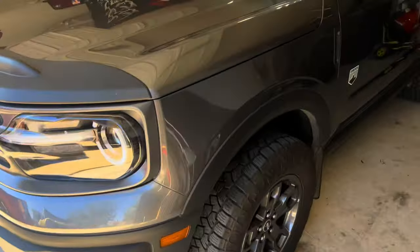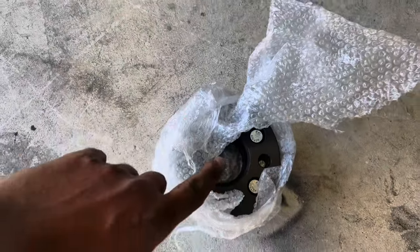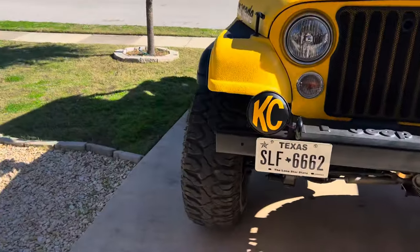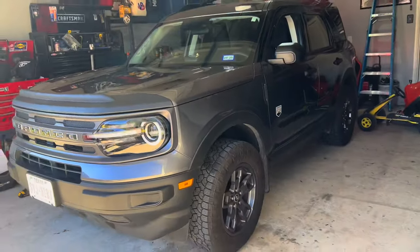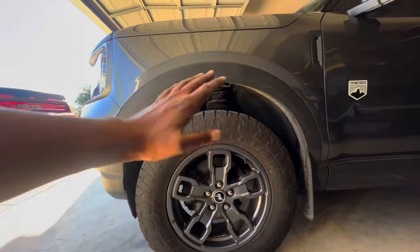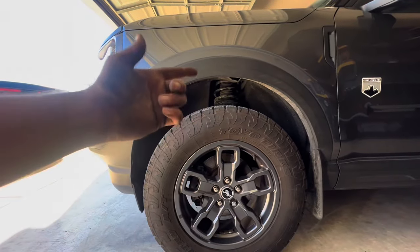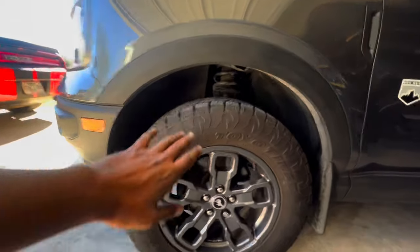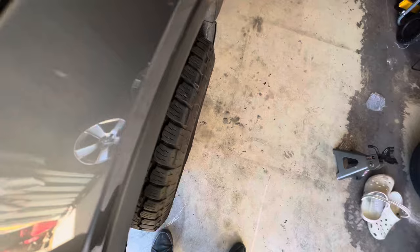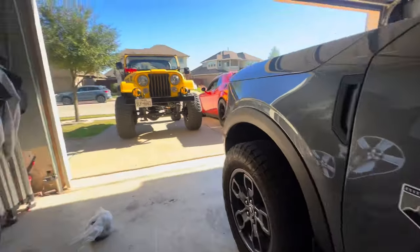The front is done. I also got a set of wheel spacers from Titan — Titan wheel spacers — I think I got an inch and a half. It's very subtle; if you look from the top you can see the tire kind of poking out. I was really trying to mimic the fitment I have on the Jeep, a little more aggressive on the Jeep but you get what I'm going for. She's kind of Carolina squatting because I haven't done the back yet. The box says about 1.3 to 1.4 inches of lift — since it's just a spacer, there's nothing to settle, this is where it'll live.